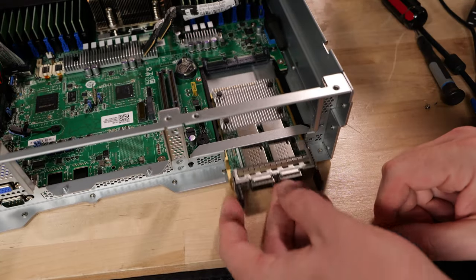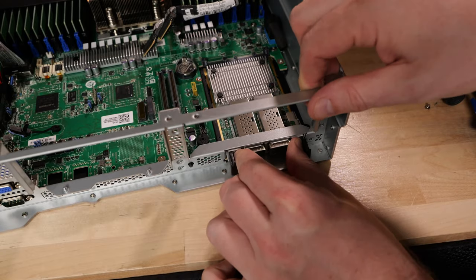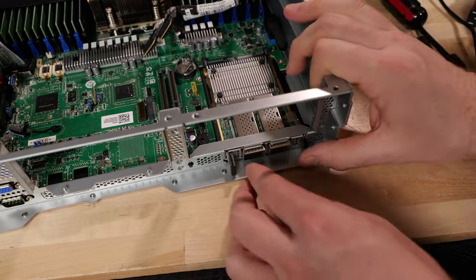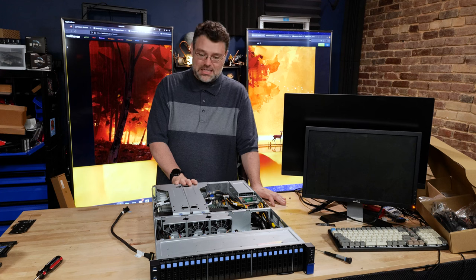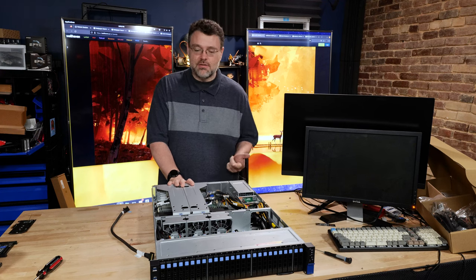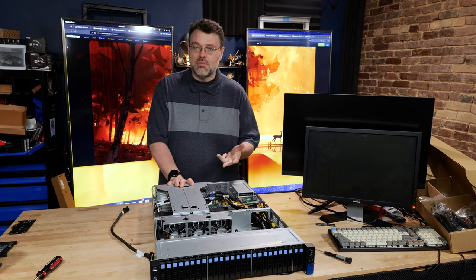And this has everything set up, this chassis, to be as generic as possible while taking full advantage of the platform. There's no PCIe lane unused. There's no feature of AMD's platform that's really left by the wayside with this platform. You've got 2 DIMMs per channel. You've got maximum power delivery. You've got a pretty good noise and airflow profile without being overbuilt.